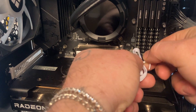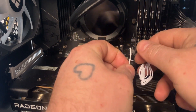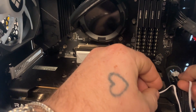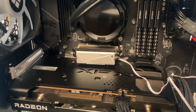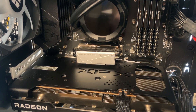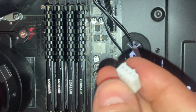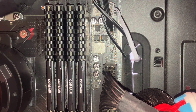Now I just have to run my cable for the fan. If you're familiar with computers you'll know how to do this. If not, you'll have a bunch of plugs on your motherboard — shine a flashlight in there and they will say sys_fan 1, 2, 3, 4, 5, 6, etc. I figured my quickest path was down through here and then up to plug into one of my fan spots. You can only put these in one way — they have notches in the top, so you can't really mess it up.